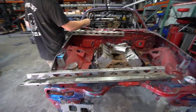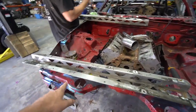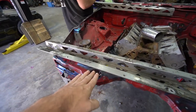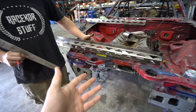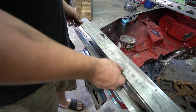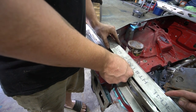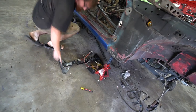The next task: these are stainless steel frame rail stiffeners, and we need to weld a plate on the side of each one for the trans mount to bolt onto. Because they're stainless it needs to be TIG welded, and since it needs to be TIG welded we've got to do it out of the car. I need to figure out how much room there is for the angle pieces — there's really not much, I'll probably have to get more. Does it have to be that long? Basically no — I did the same length.